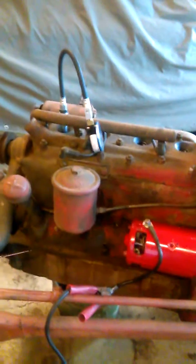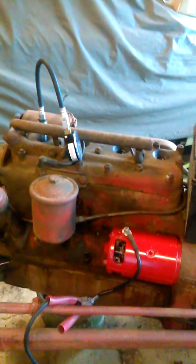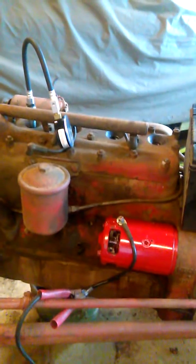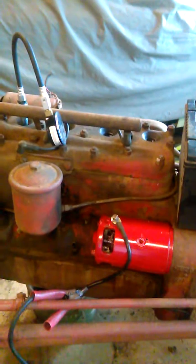So I've been soaking the engine more, and the whole thing doing a compression test is you've got to be able to spin this engine over, and the old starter has not been wanting to cooperate very well, so I've been fighting with it. I ended up completely pulling it apart the other day and cleaning all the brushes and armature, and I got it working fairly decent for now. The starter Bendix is hanging up, but that's a lot cheaper than a whole new starter.